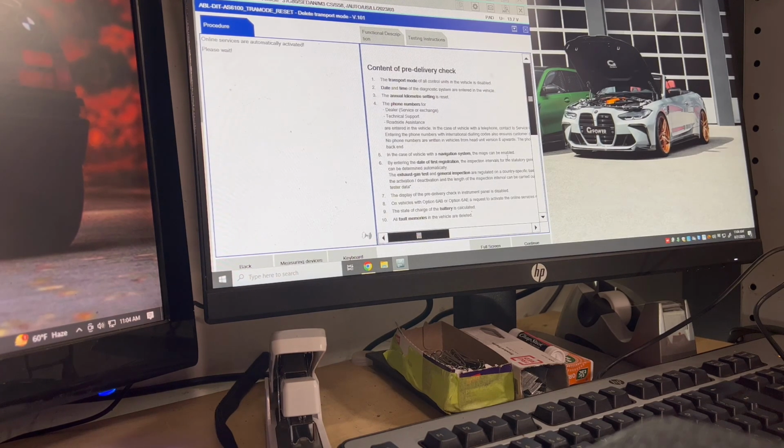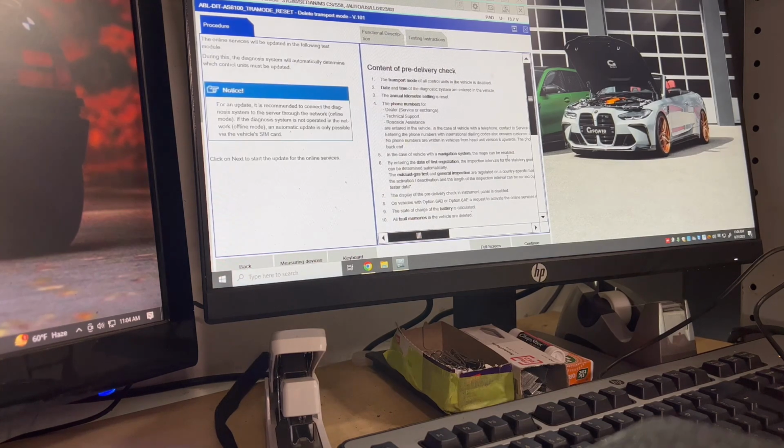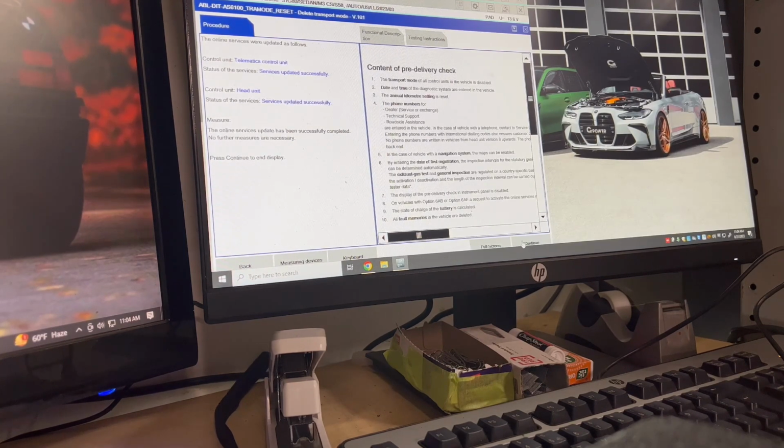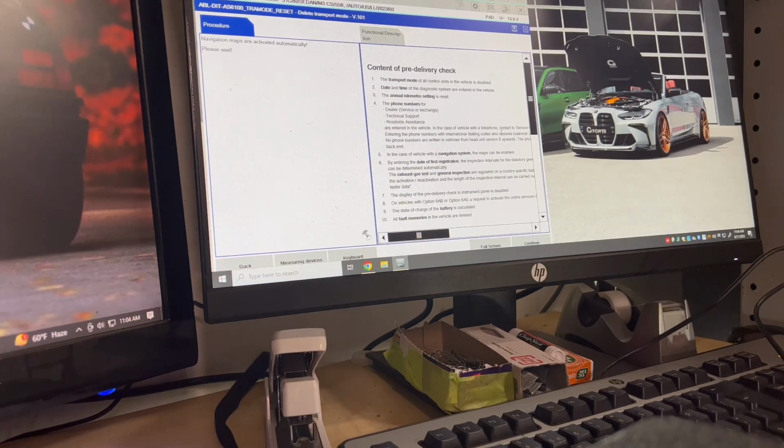We're going to program the state and or emissions inspections if required by the operating state. Check the handling and the wheel balance, absence of rattles, squeaks, any abnormalities that we don't want. The procedure is different for every vehicle. For the most part, that's generally the same. But for certain vehicles, hybrids, electric vehicles, combustion engine vehicles, there's different tasks that you must do. Adjust the tire pressures. I'm going to initialize the steering angle sensor.